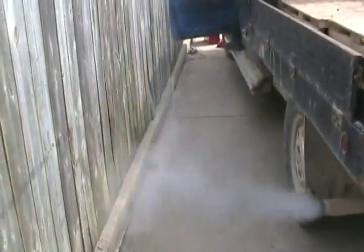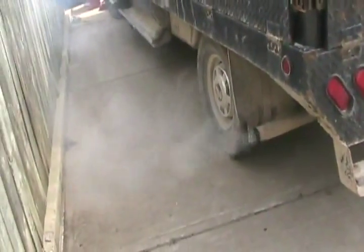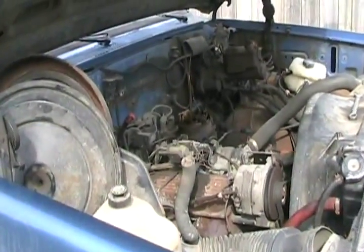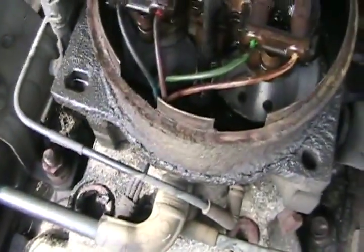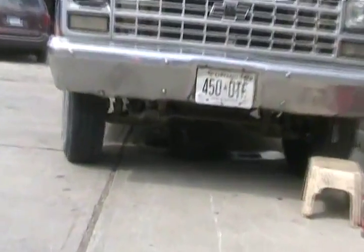She's blowing smoke — let her idle. She's blowing smoke rings. That's telling me we've got a couple cylinders still missing. Just keep the revs constant until it gets all flushed through. Motor sounds good — real good-sounding motor for all those kilometers. That was the simplest diesel mix-up repair I ever did. Didn't realize how much fuel I dripped, but anyway — it's like a puddle.